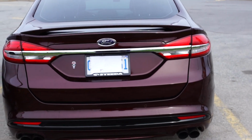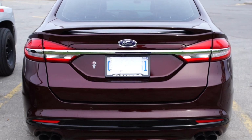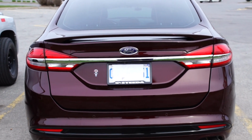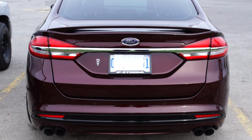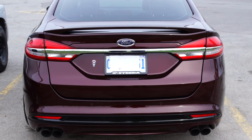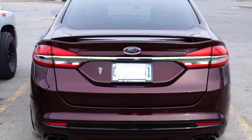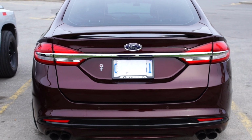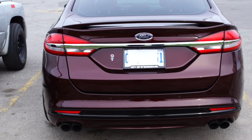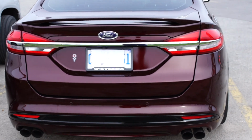But I'm doing this live, guys. We're doing this live. So PTU, change it ASAP. I went with, well, you have to run 75W140. Again, go with a high quality full synthetic oil, and I use AMSOIL. You could do the RDU. I did it at the Ford dealership, and I used their factory 80W90. I was not very well equipped to do the rear RDU.